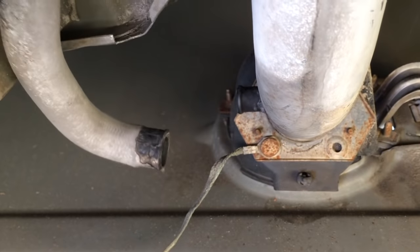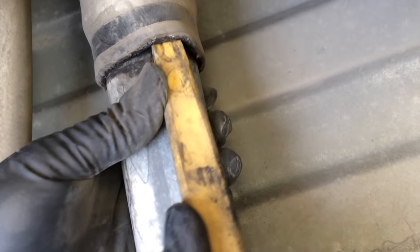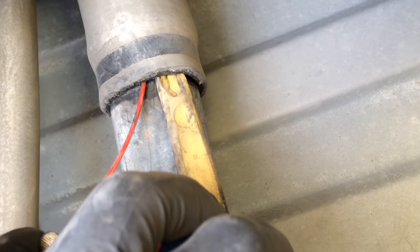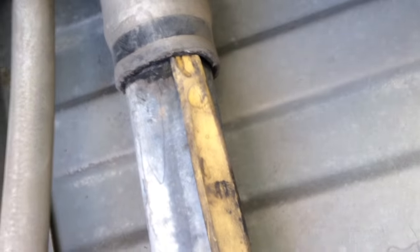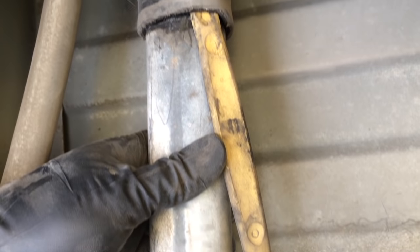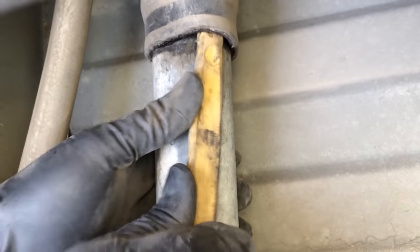For this main hose up here, it's very similar. You use this tool to get under here and crack the seal. Get your silicone lubricant, get it up in there. I take a brass hammer — I don't want any sparks down here — so I'm using brass and plastic tools, hammering it in there and working it around. I did this whole thing already before bringing the camera around. You've got to take your time and be real patient.